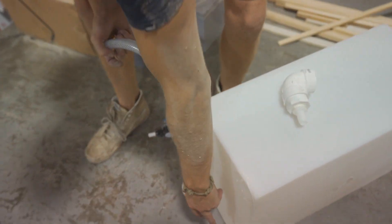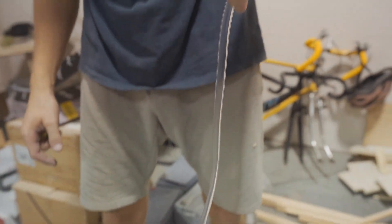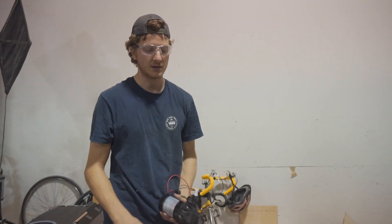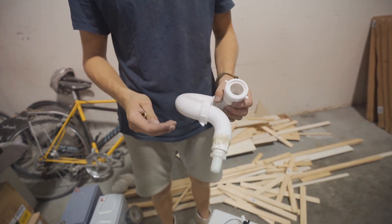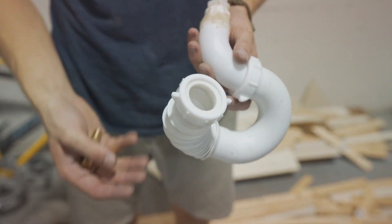This is the outlet right here — again you want to sample from the bottom of your tank so you can use the full thing. And then this is the breather hose right here, so when you're filling and when you're pulling water from the tank it needs to be able to breathe, otherwise the tank will start to concave in upon itself. There's going to be a water pump inline before the sink with a little filter on it. I highly recommend these tanks by the way — they're Class A Customs, we've put them in everything we've done, and they're on Amazon. We are Amazon affiliates, so every time you use a link of ours to purchase something we get a very small kickback, but everything helps — we're linking everything in the description. Another important thing is to run a P-trap on your van so you won't get any bad smells coming back on you.